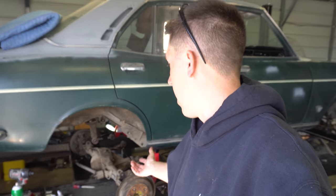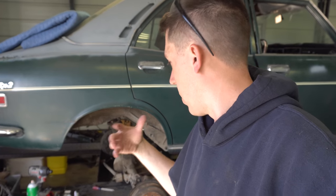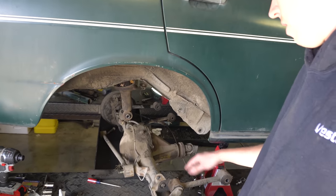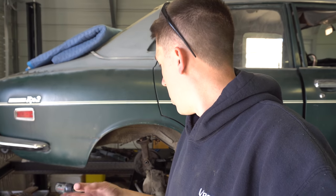My buddy Alex came over and helped me get the rear end out, so that was a big help. We're going to get it put in the truck here in a minute. I'm going to take it over to my dad's — he has a jig set up to build 9-inches. I have a 9-inch housing I'm planning on using. I either need to refab or cut off these brackets here and move them over to the 9-inch. I got to figure out exactly how I want to do that, but I'm just going to take the whole rear end over there so I know what I need to do to make the new mounts. So then the 9-inch will go back in and use all the stock locations.